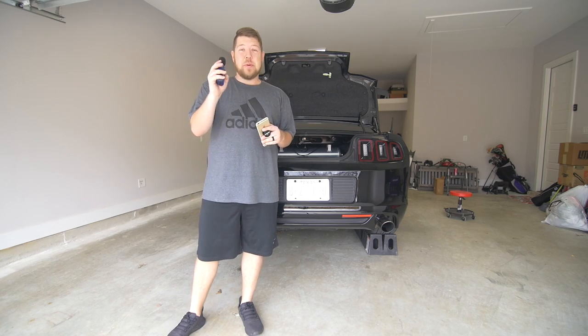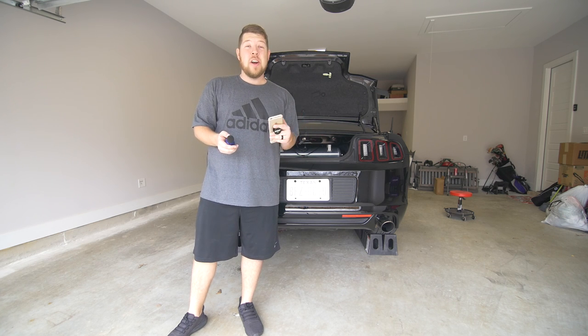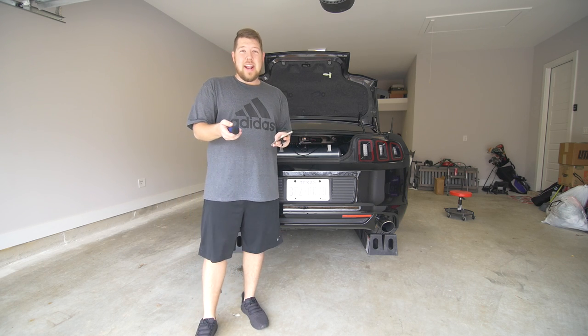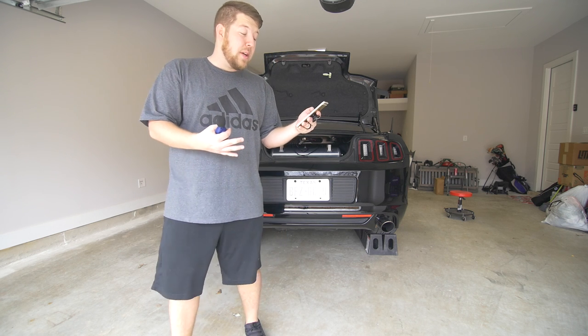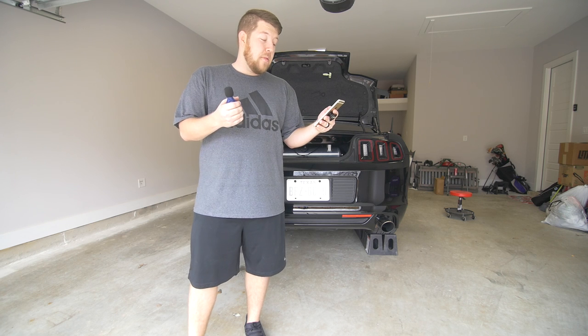I don't know if you guys saw, but when it was close to the camera, when I wasn't talking, it was at 76.4, which is pretty loud. And then I decided to walk it closer and put it right up next to the compressor, and it peaked out at 98.5. So just to give you an idea of what 98.5 is, 90 is a Boeing 737 or DC-9 aircraft at 1 nautical mile before landing.